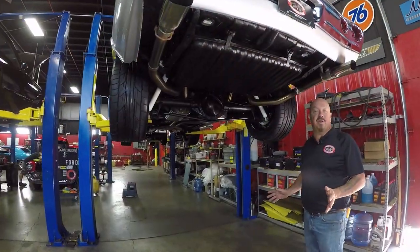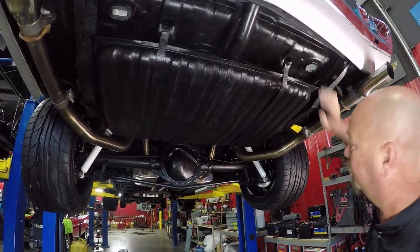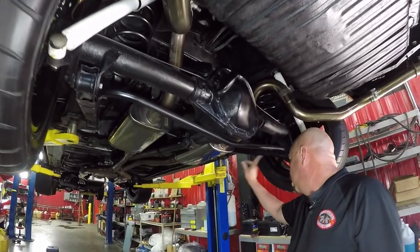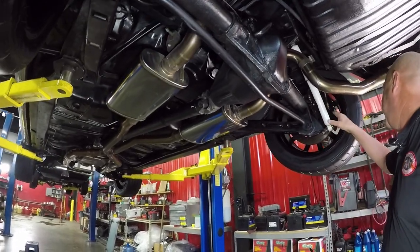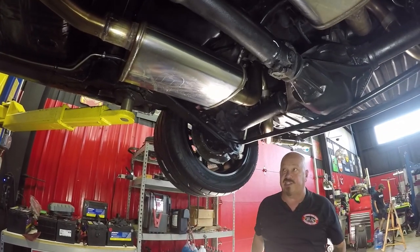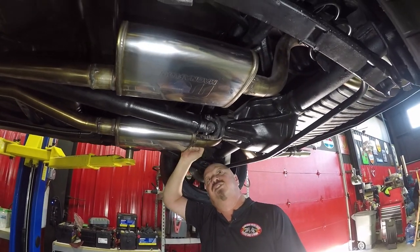All right, we're underneath this '71 Chevelle now, and it is pretty under here too. You can see stainless steel exhaust, drop downs look good, trunk floor looks nice. We've got a 12 bolt rear end in here. Bushings look brand new in the lower control arms. Lower control arms are definitely reinforced. Shocks look new. It's got an aftermarket disc brake setup on it, and they've got the drilled rotors. More than likely Wilwood. Yep, it says Wilwood, four piston on there. We've got the reinforcing braces here that the SS cars had on them. Real nice hangers here on the stainless steel exhaust system.